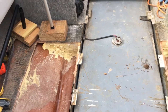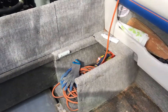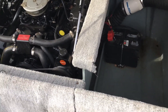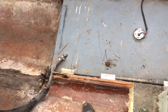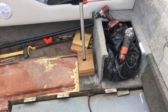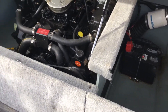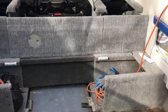It's so I can enjoy the boat since we just purchased it, and it's going to take some time to fiberglass and rebuild those bow boxes with all that grinding. I know it probably goes against what people say on the forums about doing it right the first time, but I think joining the stringers to the good wood and putting new deck on with the foam pour will be plenty sturdy until I get back at it this fall. Hopefully it'll be good for another 15 years. Thanks, bye.